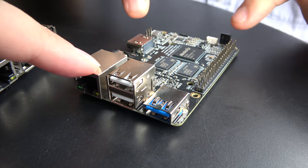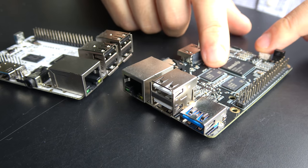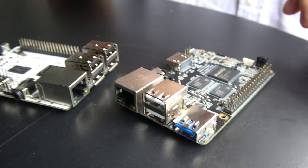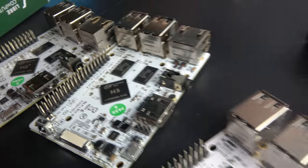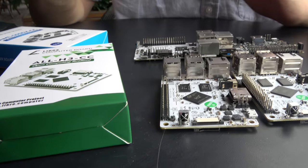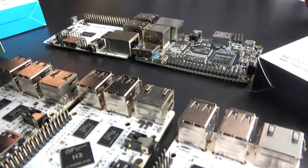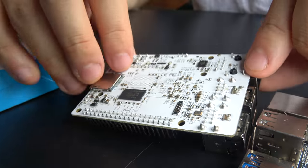If you want a really low-power solution go with the S905X; if you want a higher-end USB NAS solution, go with the Rockchip. 2GB is $50 and 4GB is $80. The DDR4 limitation is that one of these chips alone costs nearly $10, so 4GB of RAM is already about $40 before the rest of manufacturing. We use top-of-the-line memory — SK Hynix and Samsung — running at 2133MHz DDR4, whereas other vendors use 1866MHz DDR.